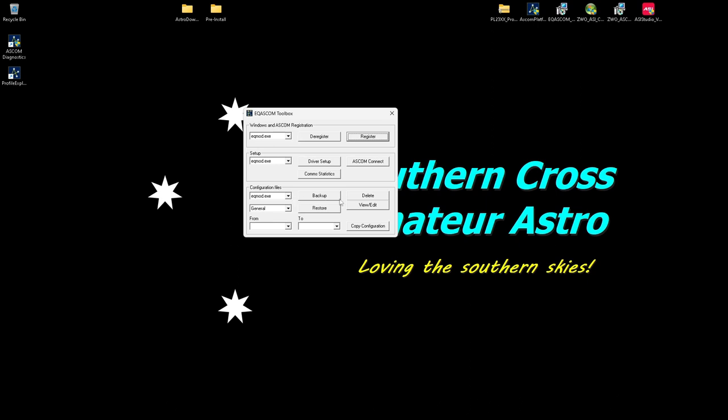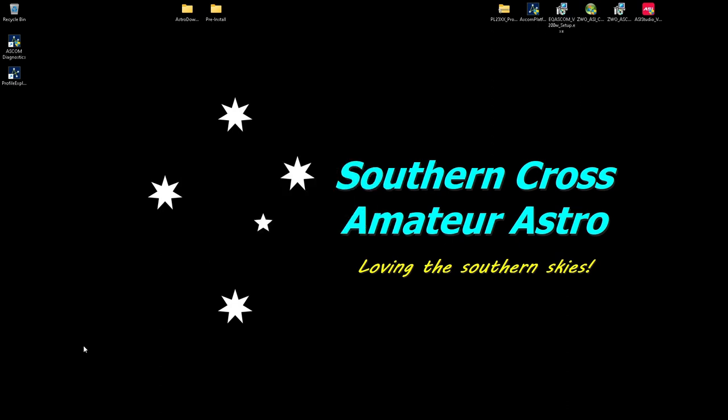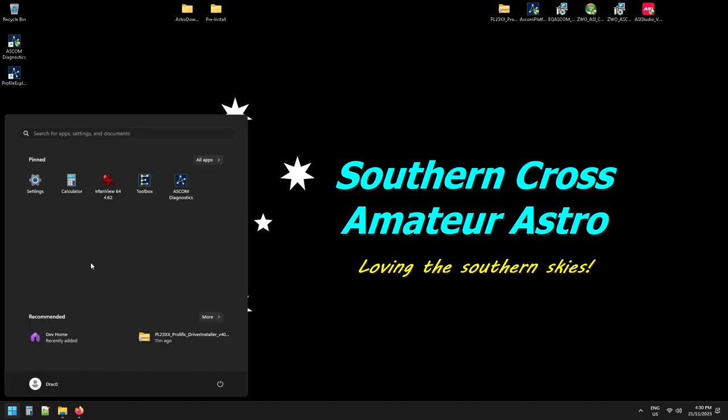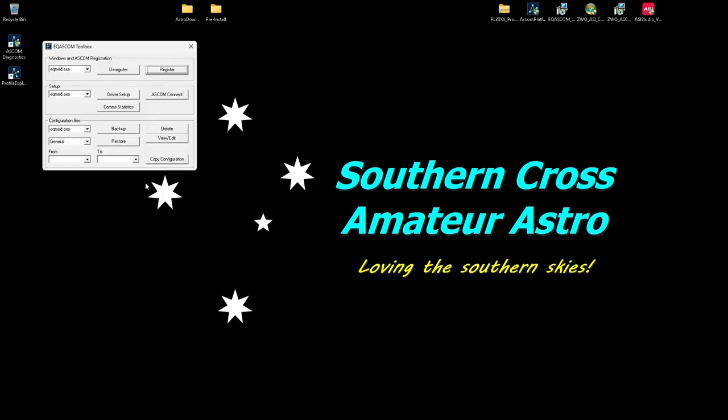And as administrator, all you do is hit the register button, and you see it's success. So that's why it failed during the install, because it needed to be run as administrator. So simply close that up again, and the next time you start it, which will be right now to configure the driver, simply go in and run it as a normal user.